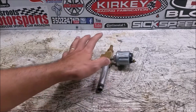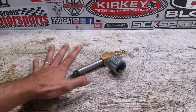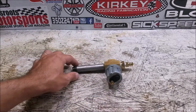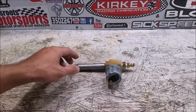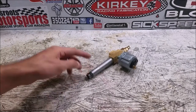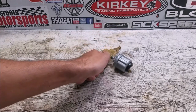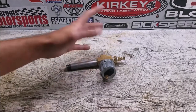While version one was in, oil pressure worked perfectly — no doubts about that. The oil temperature did start to go up on track, but it stayed around 140 on the road. I think because the sensor is so far away from the oil, even though oil will heat up and work its way out there, there's a lot of surface area for the heat to dissipate, so you might not get an accurate oil temperature. While this setup can work, I think I just got unlucky with that pipe. A stronger or shorter pipe might do it, but I'm going to go to a completely different setup.